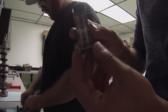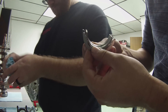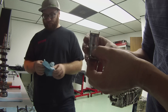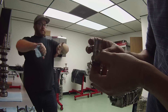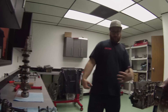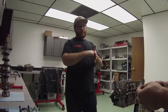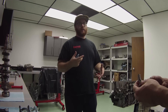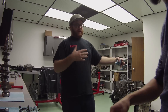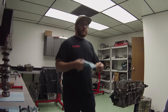The thrust bearing, as Russ was telling us earlier, allows the crankshaft to have some lateral movement from the clutch and flywheel since it's not perfectly balanced from the factory. When you disengage the clutch, it actually pushes in this direction into the engine, which closes up the oil gap and creates friction. When you release the clutch, oil fills that area and pulls it back down. In general, harmonics and everything needs this free play of oil - everything's floating in a vat of oil essentially. That's what bearing clearance is for.